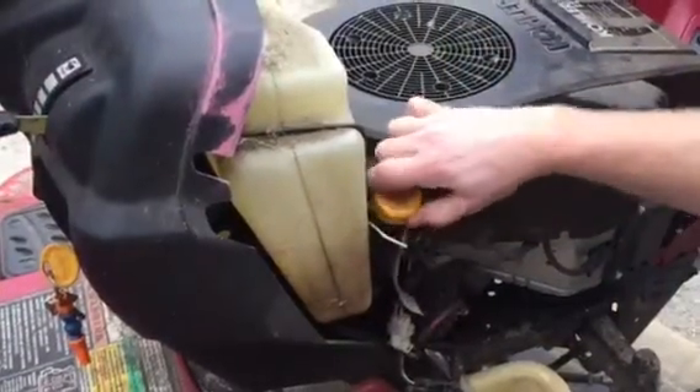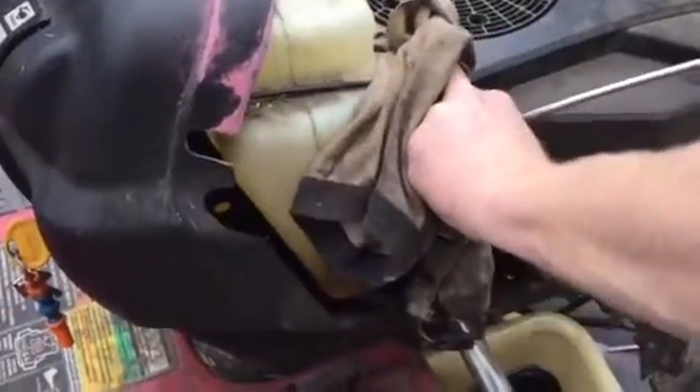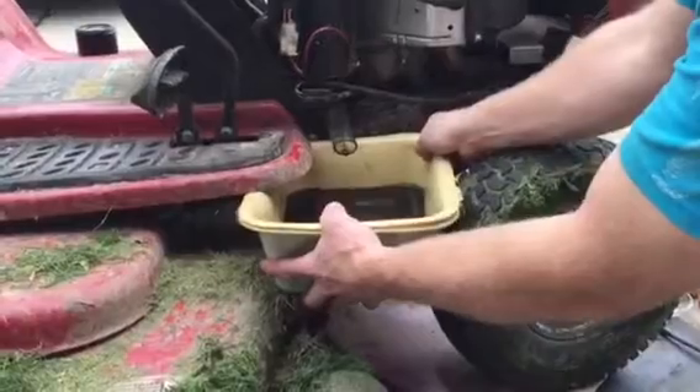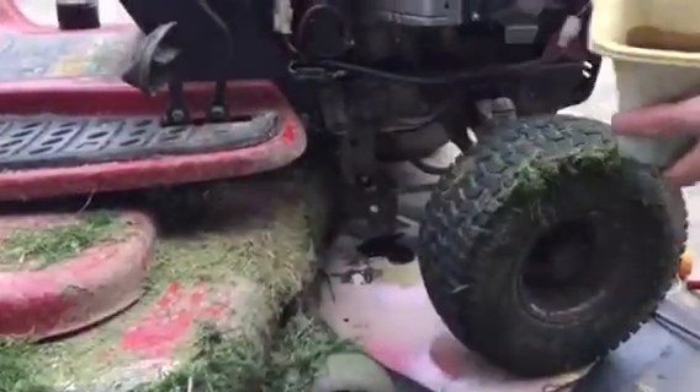Now to speed up this process, I'm going to take out my dipstick. I've got a little air hose here and I'm going to wrap it around the dipstick — this is optional — and blow a little air in. You see it speeds up the drain process just a little bit. That's an optional thing that I do. Once I get most of the oil drained out, I'm going to take my oil pan and put it out of the way.